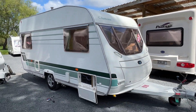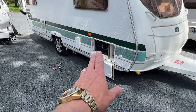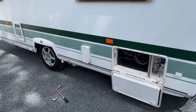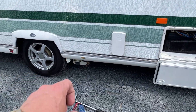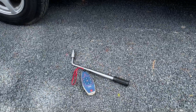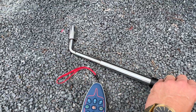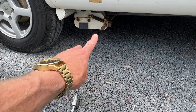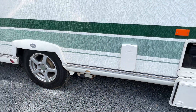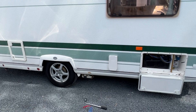It's great to park them into tight spots. First off, what you'll need is a fully charged house battery. The house battery powers the electric motors. We have our PowerTouch remote and we have our motor mover connection handle, which we're going to attach shortly. But first, we need to make sure that there is power going to the motor movers.